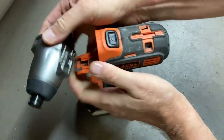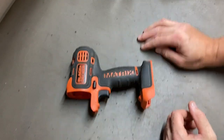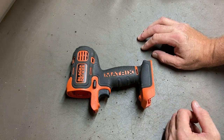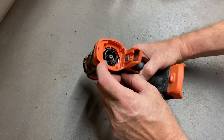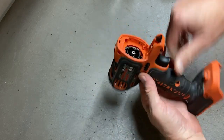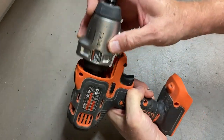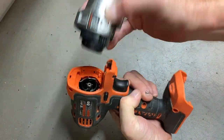Let's get the head off and the battery off. What I want to do is get the motor out so I can see if I can find a replacement. It looks like there are replacement motors online, but the trick is you can't get one with the right gear on the end. It's got five teeth and you can't find a five-tooth version — it's a special interchangeable thing that has to easily engage since it's not permanently connected in the drive.